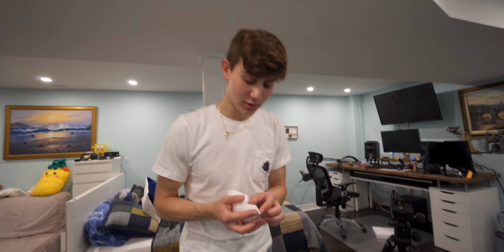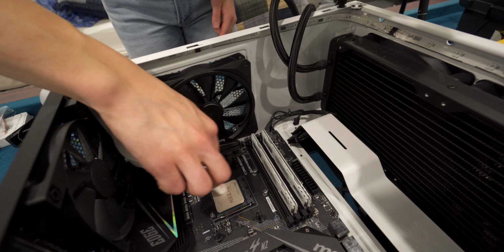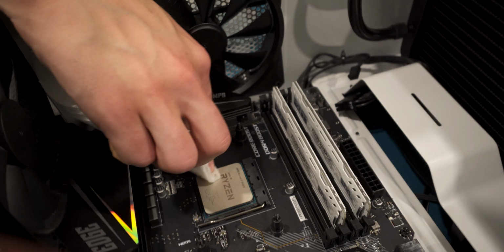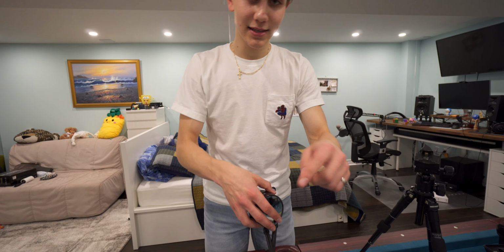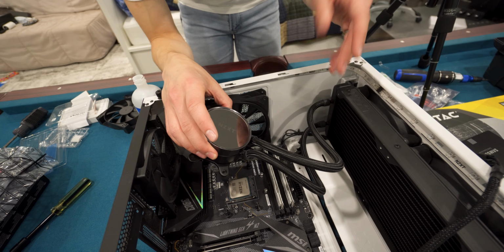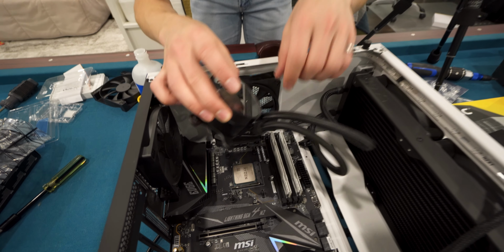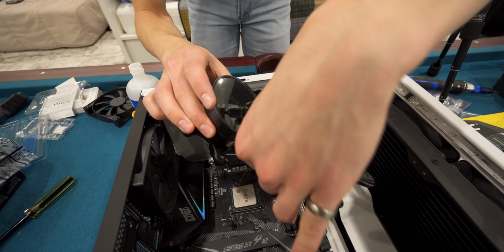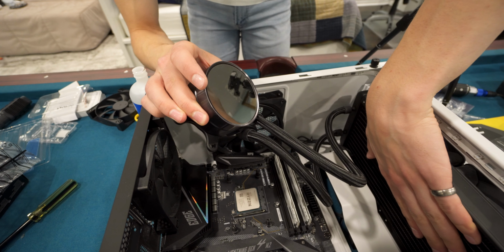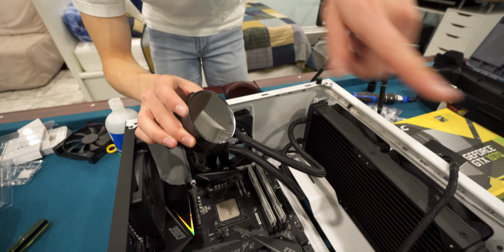What you wanna do is just clean it off a little bit, just in case, any dirt, grime, anything along those lines. We gotta clean this now, because this stuff generates a lot of heat. You gotta cool it off or else it fries itself. So this system has water/liquid going through it. The way it works is the heat goes from here, transfers into the metal here, and the heat gets carried from the water into the radiator. And then the fans cool off the radiator, which cool off the water, and then the cooler water comes through here again, same process. It's an infinite loop over and over so that it keeps this nice and cool.